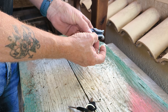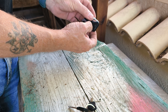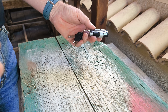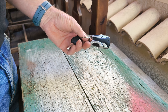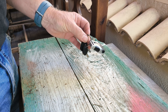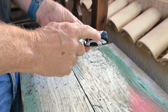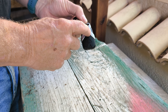Once you've got the new battery sorted, put it back into the rubber holder. You can see the two button positions are there at the back. Put it back in that section — that side goes in first — and push it back in. Make sure it's pushed into place and the battery is seated properly. Wiggle it around until the cover seats and clips back on. Then push the two side rails back on through the groove down the side.